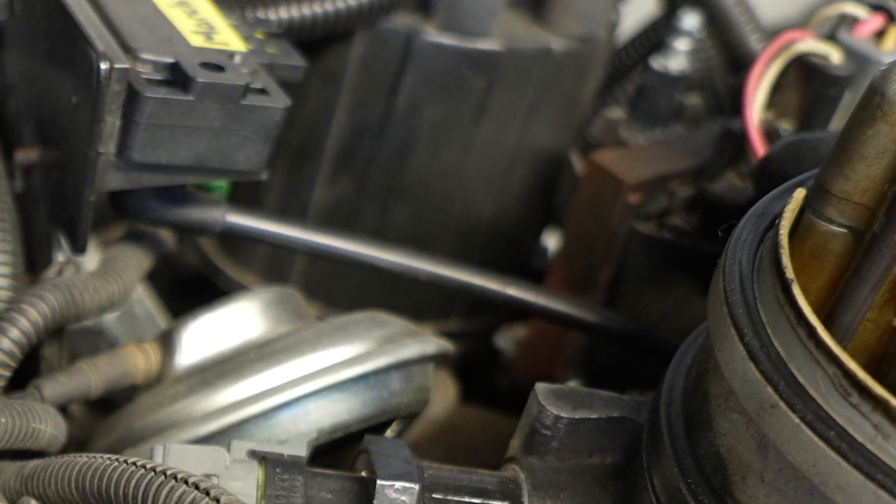Compression check is done. I tried my best to follow the directions out of the Chilton manual and also the directions that came with the compression tester by Innova. I am not a professional technician — this video was for entertainment purposes only. I did notice some sparks coming off of the coil post, which is probably not good. There's probably a better way to disable the ignition system rather than simply pulling that coil post wire. In any regard, I was able to get it done and the numbers are all really good. If you have anything to add, comment down below. If you enjoyed this video, please hit that thumbs up — it does help the video and the channel. If you're not a subscriber, consider subscribing.